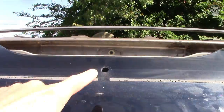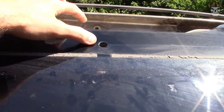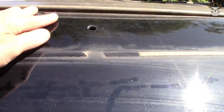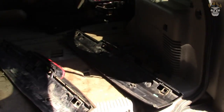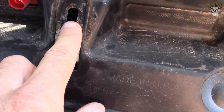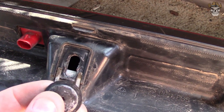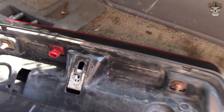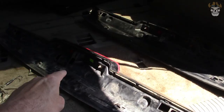On the Yukon, I removed the rear third brake light to show you why what I did here is not going to work. The middle hole I was utilizing is way lower on the glass. If you imagine the glass coming across right here, it's quite a ways down. On the Escalade glass, the third hole is way up here where the other one has a cutout all along here. So how I'm utilizing the middle hole on the third brake light is by moving the clip all the way to the bottom of this hole. Normally your bolts go through right here, but if I move that clip to the bottom, start the threading, use up all the slack, and tighten it down, I can install that bolt on that glass.